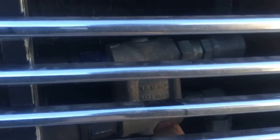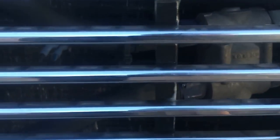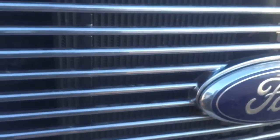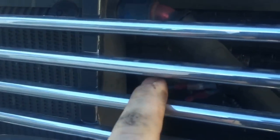The hose comes up from the bottom of the truck. This is the thermostat I was talking about — this is the thermostat that is mechanically controlled by heat, it's a thermal thermostat. The oil comes up, goes through there, and then goes across here into the heat exchanger. You can see the heat exchanger there. And then on the back side there's a fan; the fan is hooked up to a relay. Oil comes back out, and then the hose comes up and through here, comes up and over, and goes back into the top of the filter housing. There's no filter in the top of that housing, but this is how it's set up on this truck.